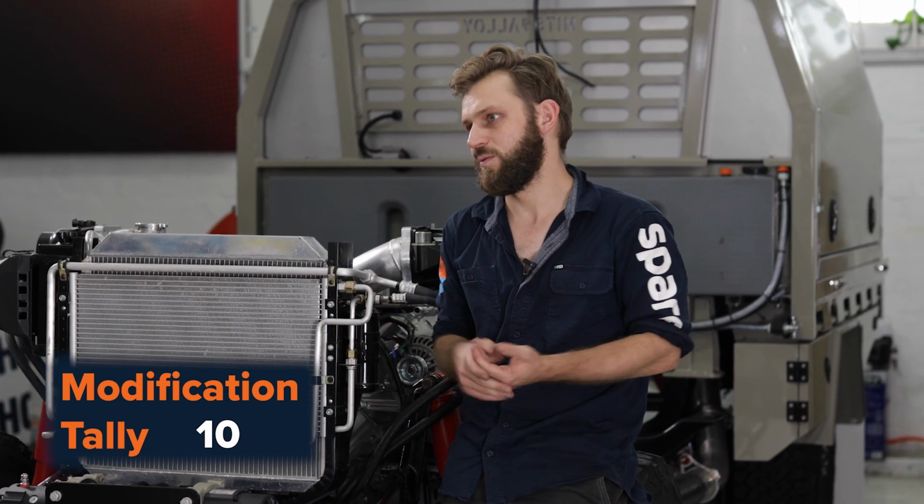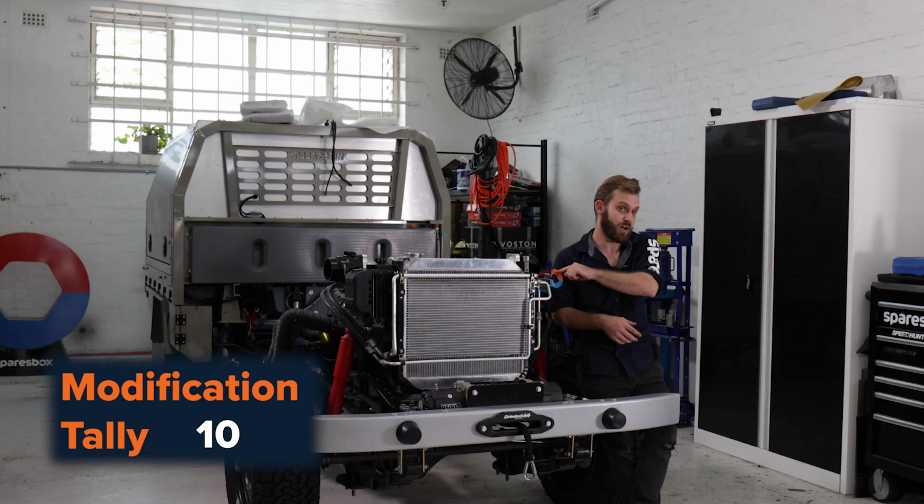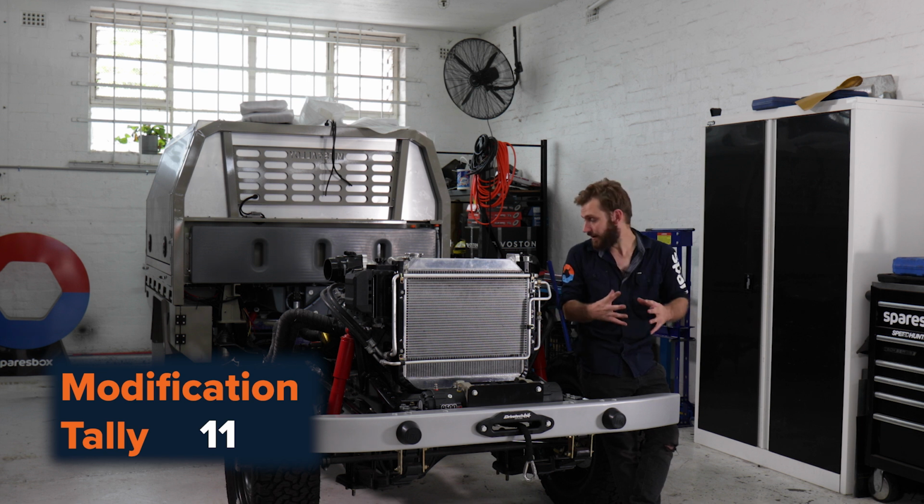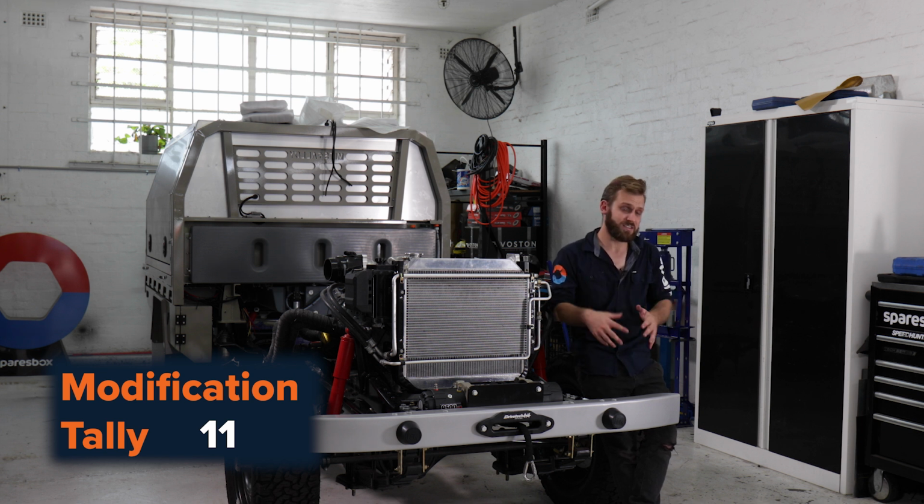We actually found out the hard way as well. There are 2 different input shaft sizes on that generation of gearbox. So we also had to get a surprise about 1 inch spacer off Castlemaine Rod Shop the day we tried to fit them together. But other than that, it went together fantastically.